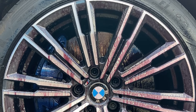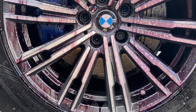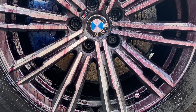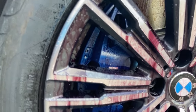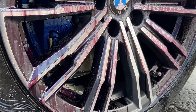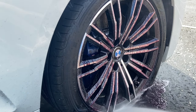The topic of whether a fallout remover is a wheel cleaner is a very touchy discussion. The chemical process that causes the iron particles to be easily removed also accelerates corrosion on ferrous metal parts, so brake components, suspension components, wheel bolts, etc. The localized acidic reaction can even play a part in hydrogen embrittlement in certain components. So the safest option would be to remove the wheels as part of your chemical decontamination process. That way you're not getting any unwanted chemicals sprayed over these sensitive metals.